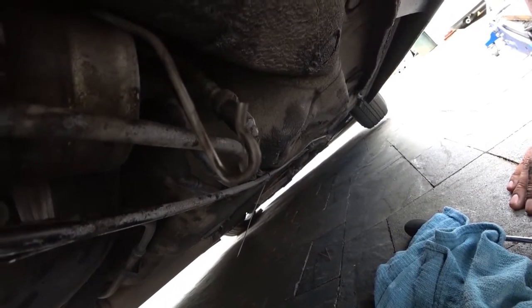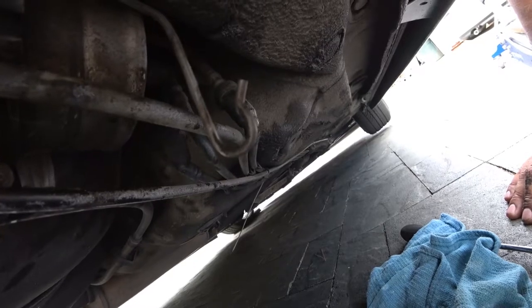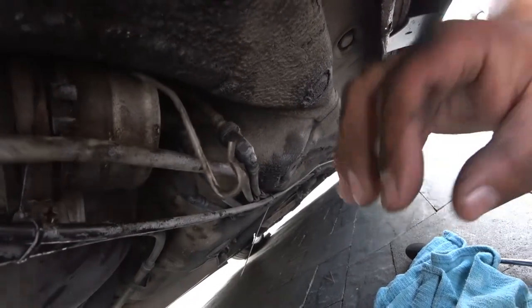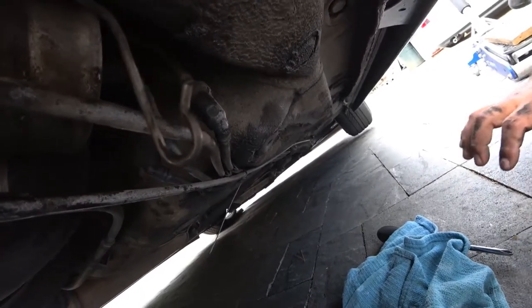While you're doing this, remember: take the key out of the ignition. You've got to make sure the doors are closed and don't tell anybody to open any of the doors. Because what's going to happen is the fuel pump will prime and it will squirt a ton of fuel out. You're just going to have a mess. Remember that.